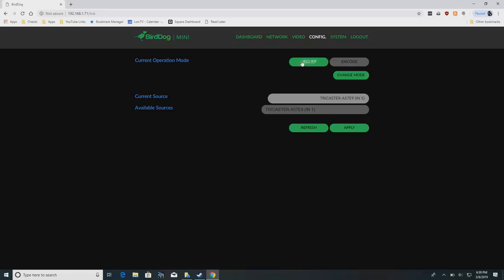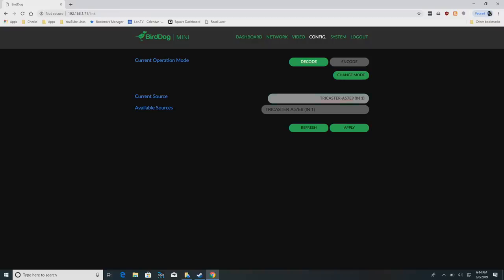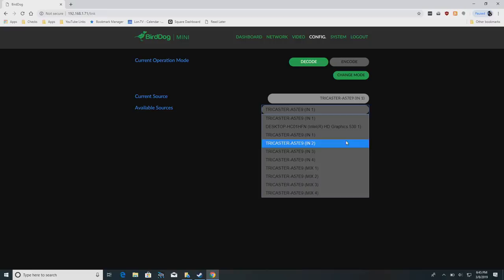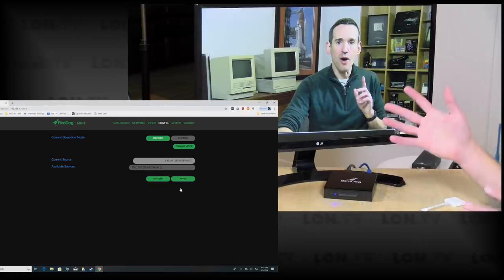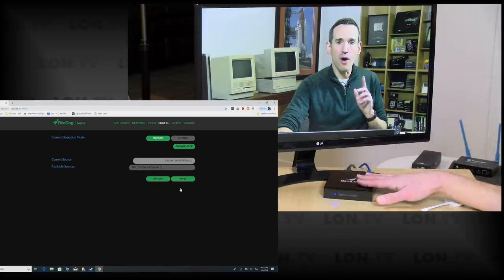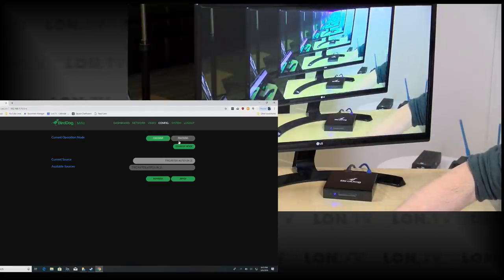Let's go back to configure and get this thing working as an NDI client. We've got the BirdDog now operating in decode mode, and you can see we have a TriCaster here on our current source — this is the first input from my TriCaster. Switching over to my desk you can see the monitor going with my image on screen. Going back to the control panel and selecting the second TriCaster input and hitting apply, what should happen is a relatively quick switchover from one source to the other. I found that sometimes you might need to do a device reset, sometimes it works, sometimes it freezes, and sometimes you just need to click apply again — and there we go. You can fairly easily switch back and forth here, and it can work very well as a way to get high quality video output from your TriCaster or another NDI device.